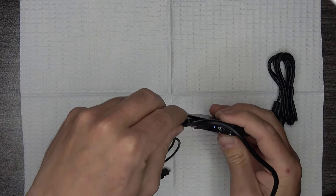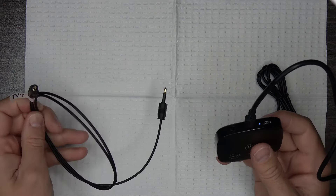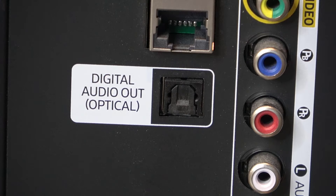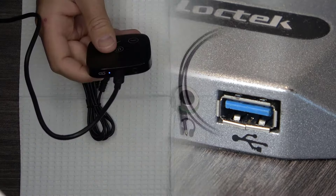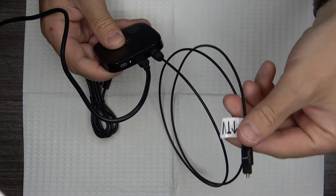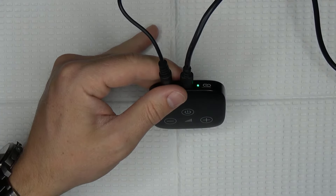Now we need to plug in the audio cable that we are going to use with our TV or other audio source. Both the Toslink and the analog cable will plug into the same dedicated audio socket on the TV connector, but we need to make sure we use the correct cable for our chosen audio source. If you have a newer TV, you should have an optical audio out port somewhere along the back or side of the TV. If you are using an older TV, or plugging into a different audio source like a stereo receiver or a desktop or laptop computer, you should see a 3.5mm headphone out or audio out port on the source device. Once you have determined which cable is correct, first plug it into the TV connector, then plug the free end into the TV or other audio source. If the TV is on and playing audio and the audio cable is successfully connected, the indicator light on the TV connector will turn from white to solid green.